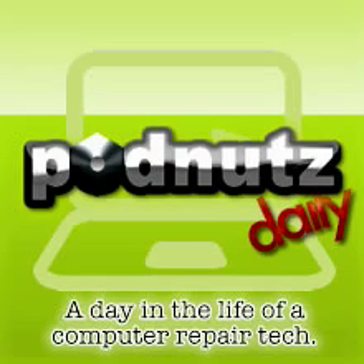To me it sounds like an overheat problem. I put the whole laptop back together, the fans were spinning, the heat sink was on, and it was still doing that. So I thought maybe the hard drive. I took all the components out and opened up the computer again. Here's what it was — this is what it usually is when you turn on a computer and it runs for a few seconds and just turns off. It is an overheat problem. I didn't have the heat sink fastened on properly on this computer.